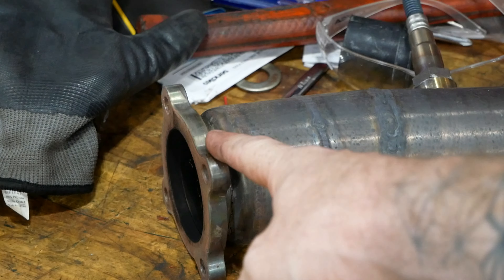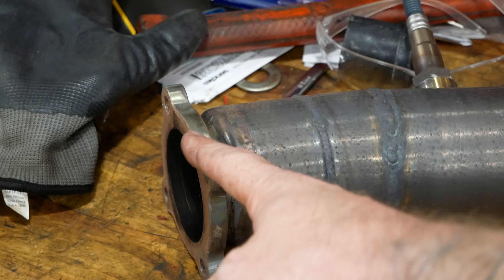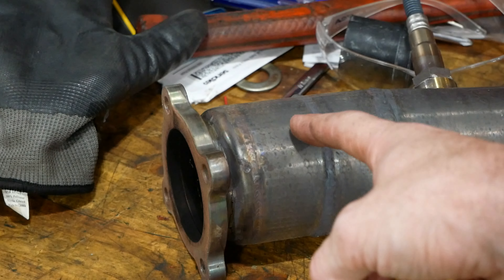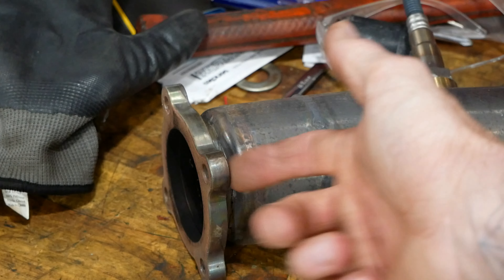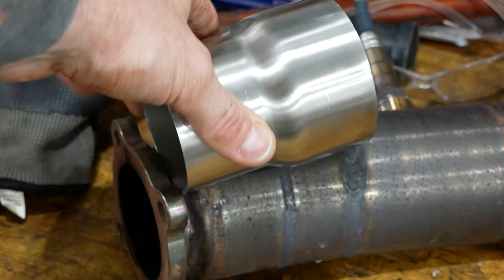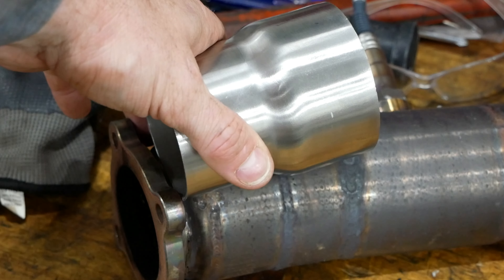The plan is I'm going to take this flange, basically finish that crack, break it off of here, and sand down and grind down all the remaining pieces of three-inch pipe. Then I'm going to cut this back and use a two-and-a-half-inch to three-inch adapter to upsize it, so out of the flange it'll be two-and-a-half and it'll step up to three inch. It'll look a little bit cheesy, but it should allow better access to put bolts in there. Here's the two-and-a-half to three-inch adapter — got this on Amazon. We're going to cut this pipe back right to that weld, grind off the flange, and this piece is going to go in its place.